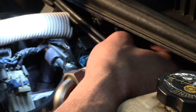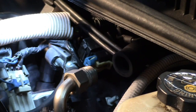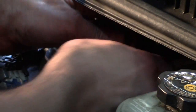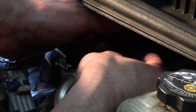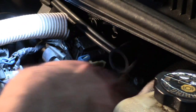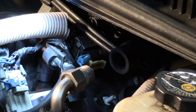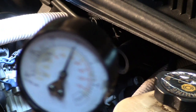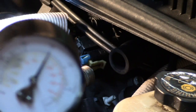I'm going to take my vacuum hose — I've got the vacuum hose from the solenoid now — and attach my vacuum pump to the hose from the solenoid. The solenoid should right now be closed, so I'll go ahead and apply vacuum. We can see that I have vacuum there, so the solenoid is closed as it should be with no leaks in the solenoid.